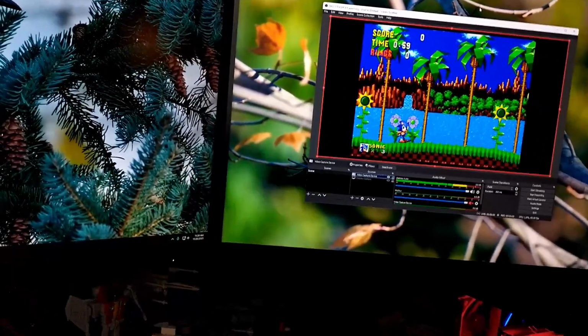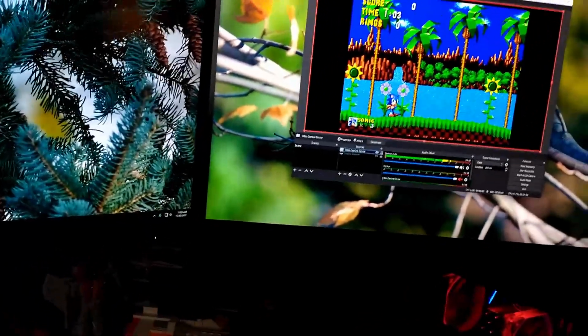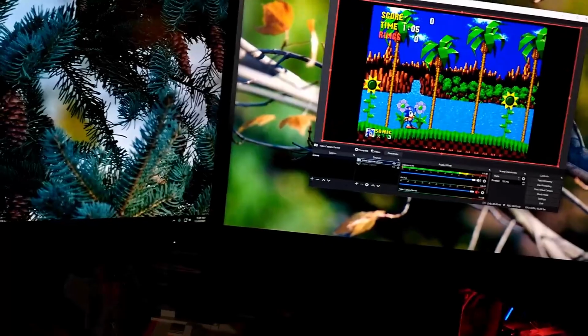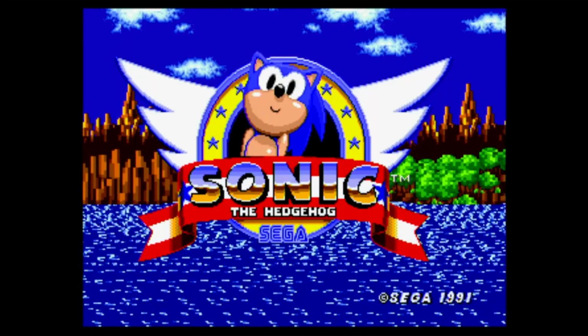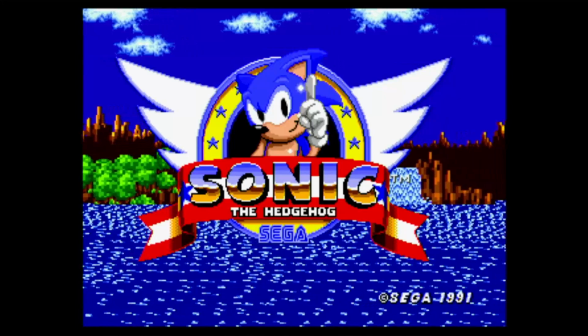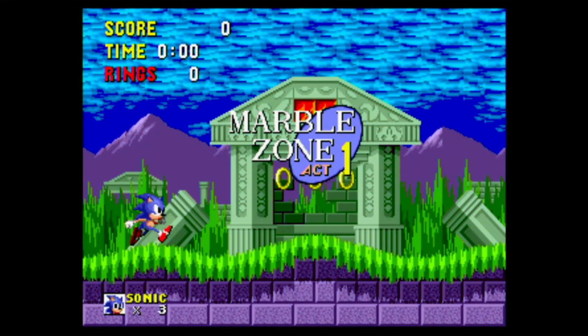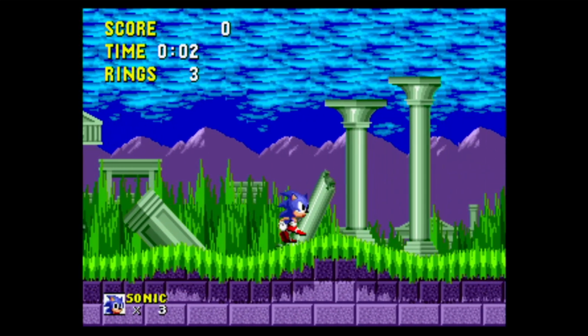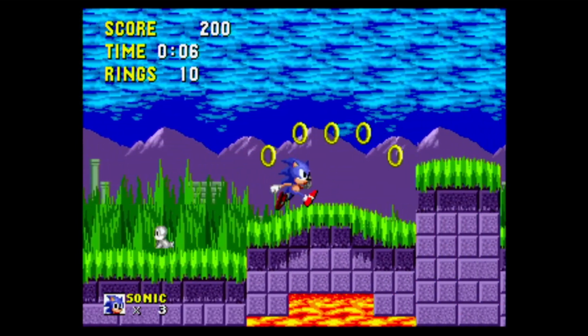It's actually surprisingly low lag, especially considering it's USB 2. So we'll take a look at some of these recorded clips. This thing's really meant for 30 frames per second. I went into the settings. The default setting was that it would record at your screen resolution, so for me, that's 2560 by 1440. This first recording was recorded at 2560 by 1440 at 30 frames per second.